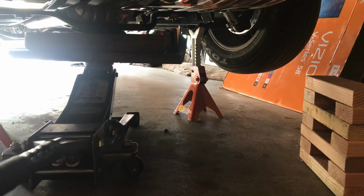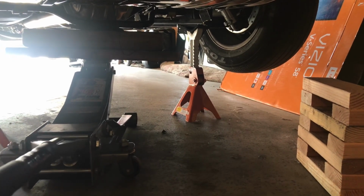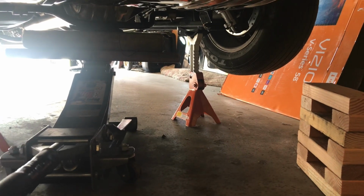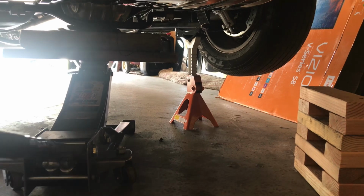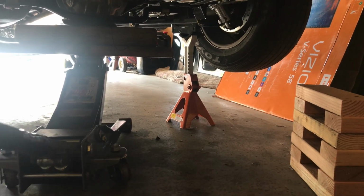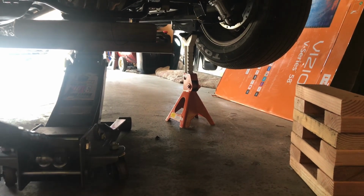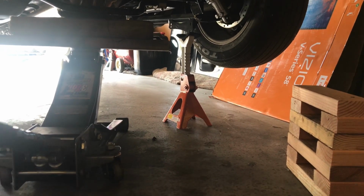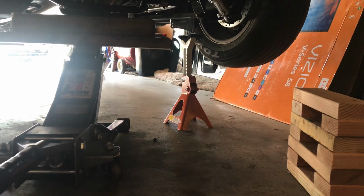Definitely don't want to get under a vehicle that's got blocks on it like that. We're just going to slide the wood blocks that we made under it. Careful not to touch the car so you don't have anything come down on you. The jack might have gone high enough, but we were almost at the limit as it was with the jack height. I'm gonna have plenty of room to work under here now. It's gonna feel like it's air conditioned too.